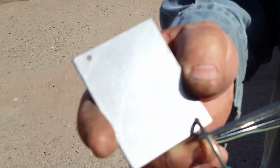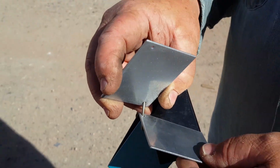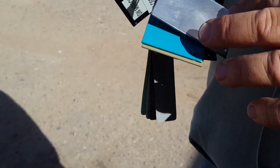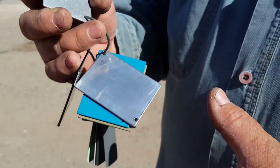And then here's the high-tech chrome. It's actual chrome. It's like a polished aluminum. Doesn't look like it, but it is. And if you look at that, you see the black in there. That's because we didn't clear this. Dirt washes off the metal that's in the chrome that was giving it the shine. Oh, I see. And so it's very unstable to UV. So you've got to put a gloss over it, and when you do that, it reduces the brightness.